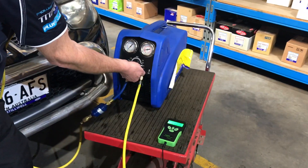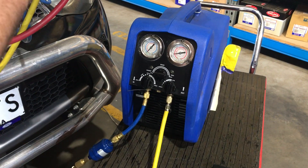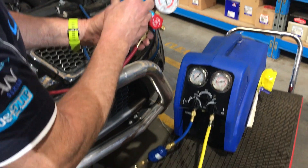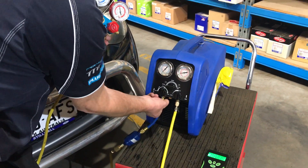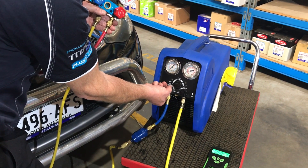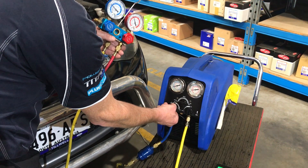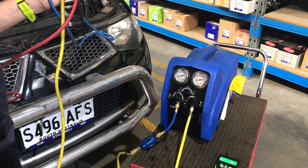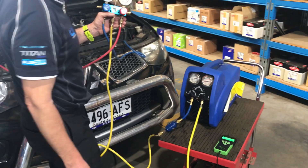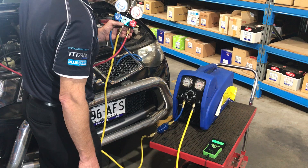Bring the high side around to open, or the outlet around to open. I'm going to open the vacuum line on this. I'm just going to put pressure into the inlet of the pump and gradually open up — that will start receiving refrigerant from the car. You'll notice that I haven't opened up all the way so that we make sure we don't get liquid into the recovery machine. We'll watch that and let it settle for a while.